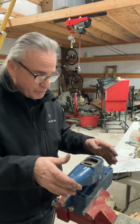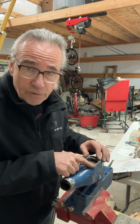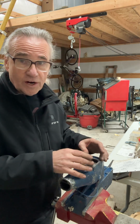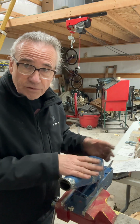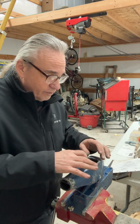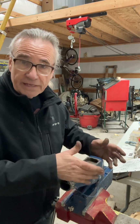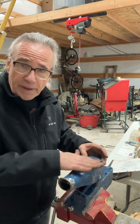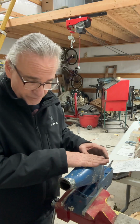Now, when you took yours apart, these studs, one or more of them, probably all of them broke. They like to rust. Much worse if it's been salt water, but again, these motors are 60 years old, some of them. So you likely will have had to cut those smooth, drill them out, and tap them. I'm using an old manifold here just for the video, but you want your mating surface to be clean and smooth.